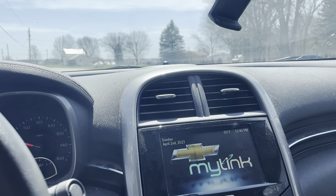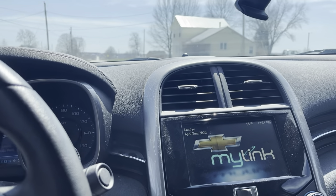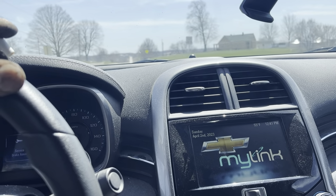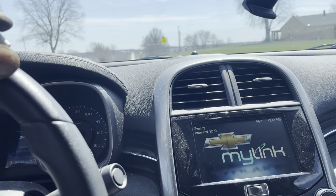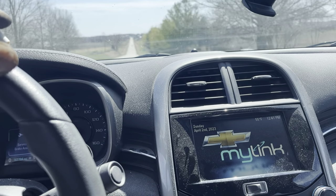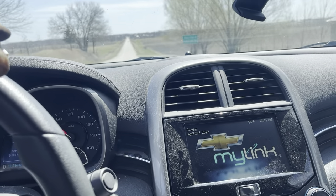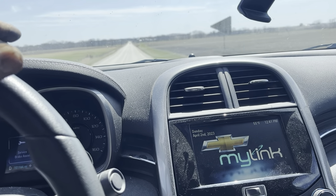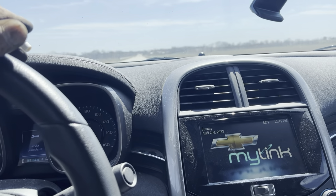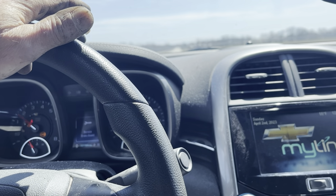Taking this for a test drive — let's see if it seems quieter. So far, so good. Get it out here on the highway so we can get a little speed out of it. You know, that hub I took off wasn't frozen there very bad and it still had paint on it, which makes me think I've probably replaced it before — I lose track. I really wish they hadn't gone with hubs with sealed bearings in them; the old tapered, greasable bearings were just so much more reliable. Yeah, we got her up to 60. Sounds pretty good. I'd say we got it fixed.